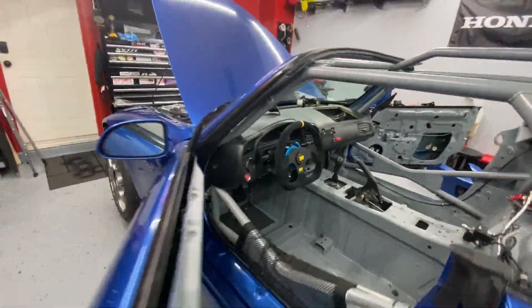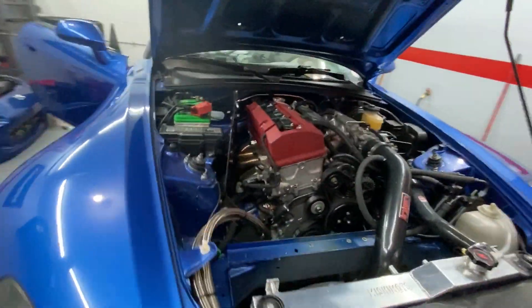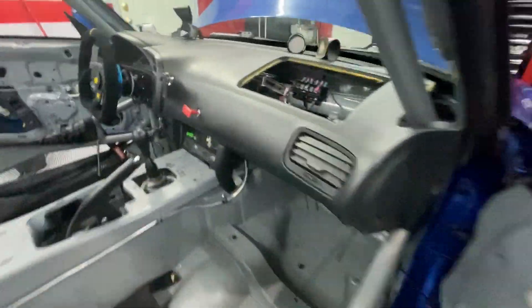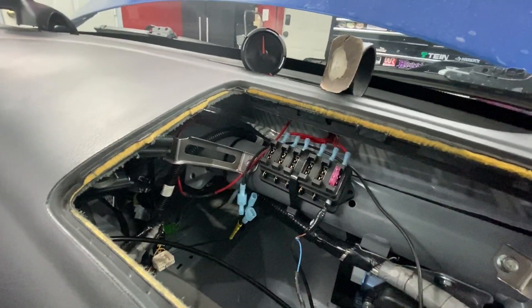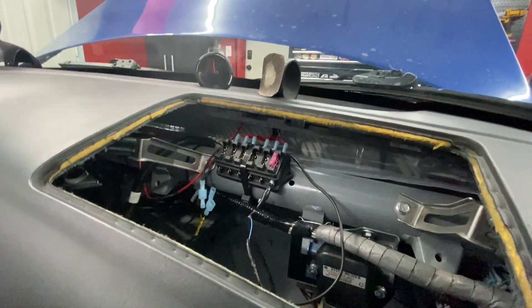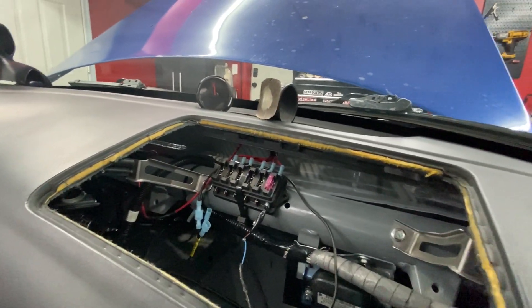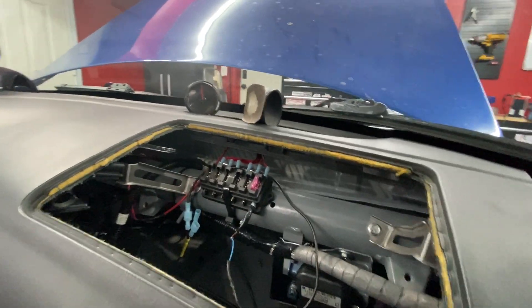I have the transponder hooked up to the car with the wires going through here. I added a mini fuse box for the setup — I got a quick disconnect on everything, on the grounds and on the power. This is going direct to the main fuse box. I need to tidy up where some of the wires are ran, but since I'm not done wiring everything, I haven't yet. Everything is fused. If you're doing something, it's worth doing right, especially when it comes to electrical.